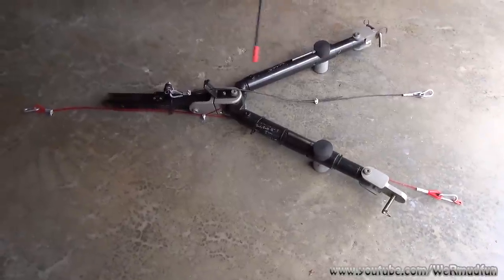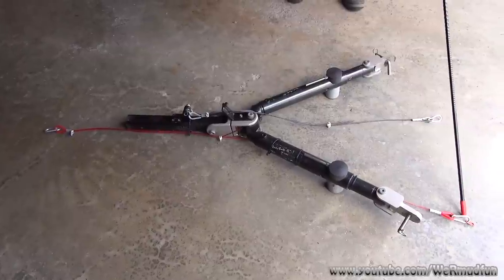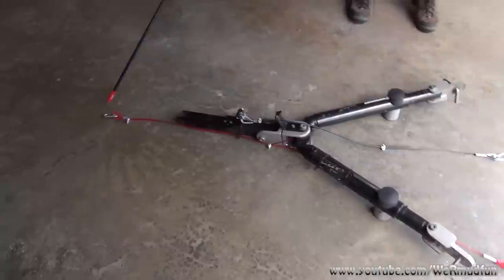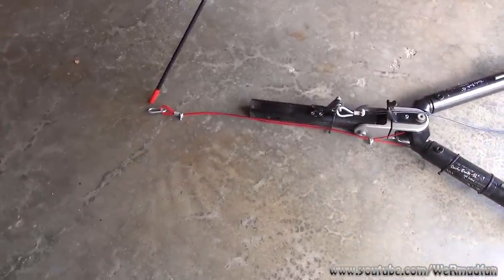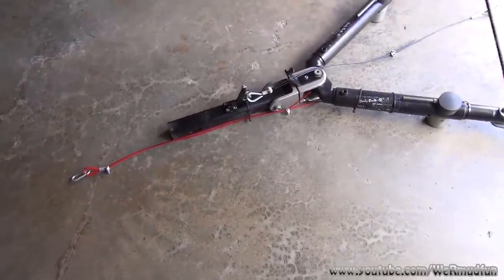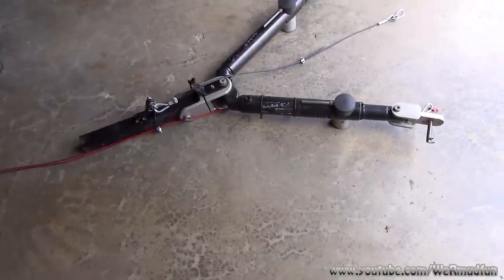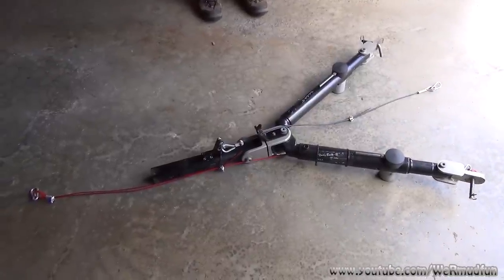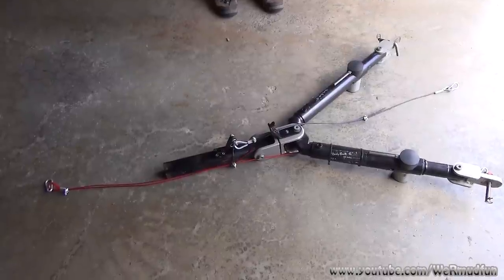Besides safety cables, which I've taken off just for clarity so you can see everything, you have three hookups. You have the breakaway. On the other end of that, it hooks to a cable that is attached to the RV. That way, if for some reason this was to break, then this cable would activate, pull, and turn the brake on on the Liberty — making it so that it would not move anymore, which is a lot better than having a runaway vehicle behind you smashing into you.